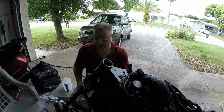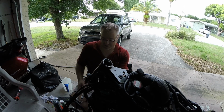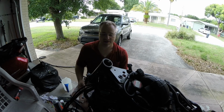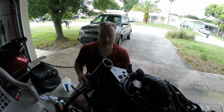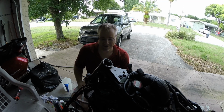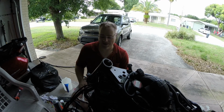Okay, I have to realign the forks because all the hammering and stuff kind of drifted them around. It's just loosening the bottom pinch bolts and running the axle through the bottom, making sure they're straight, putting everything back in loosely, and then tightening everything back down once all the pieces are in place. That's it. Let's go ahead and reassemble this steering. That might be it for me today. This has taken all afternoon. Oh, never again. Never again.